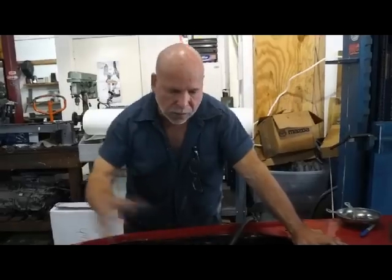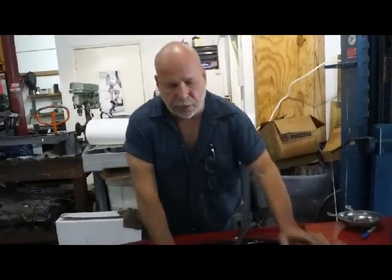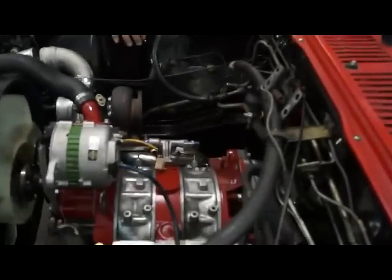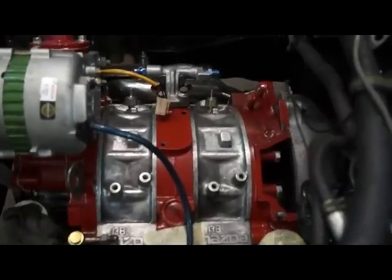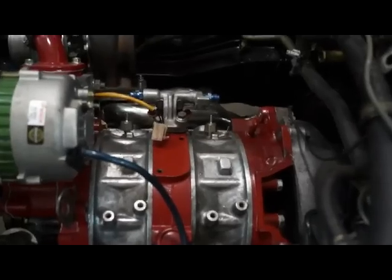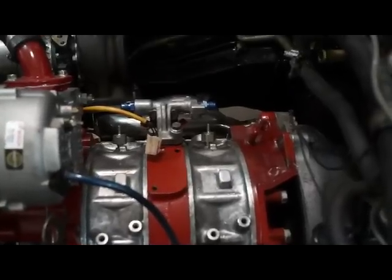Basically, you take out your 12A, you bolt your 13B into the original first generation gearbox. This gearbox, just like the RX8 gearbox, is good for about 380 horse, no more than that. Actually, this early box is probably a little bit stronger than the RX8 box.